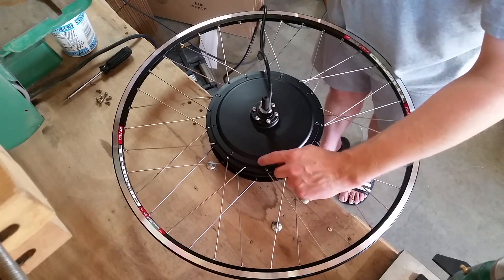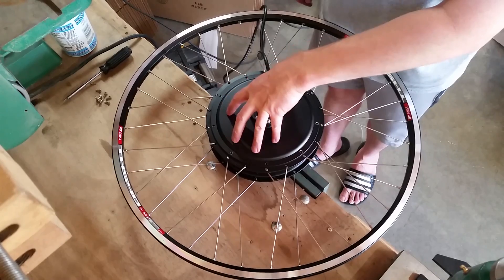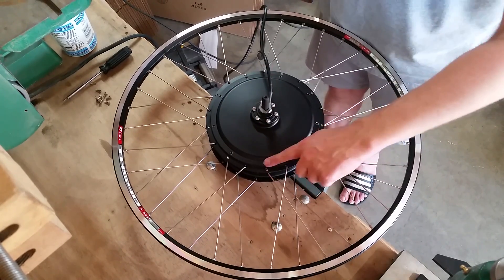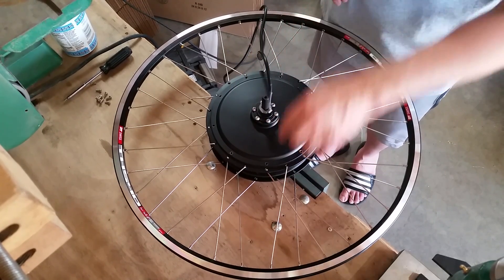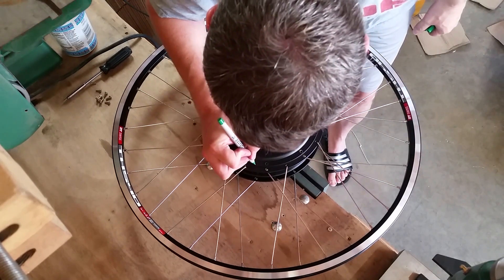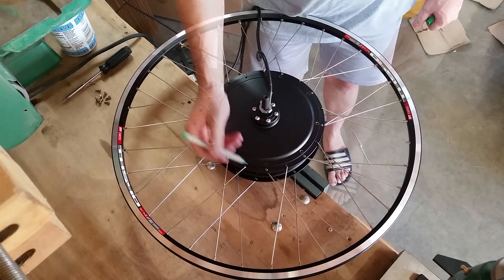The other thing I'm going to do is mark the hub cover and the rotor for their position so I can put it back in exactly the same spot. There may be a specific rotation where these don't line up perfectly and so I want to go back exactly how we're pulling it apart. I just made a little triangle here and here.